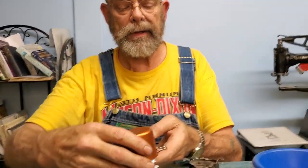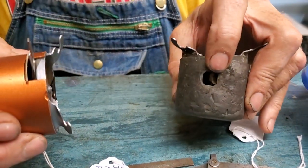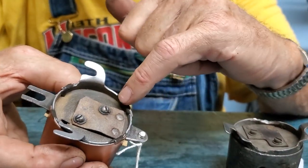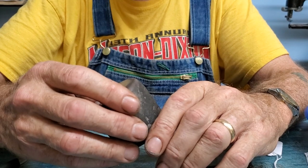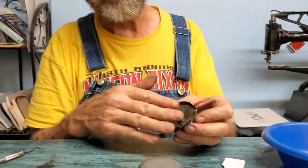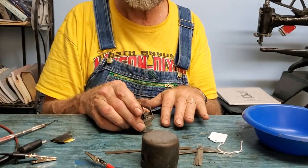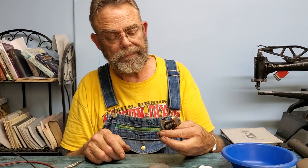The very early cutouts — up to January 1928, the copper-plated ones — are built quite differently. They have integral lugs and the cover is open on the bottom, with a cardboard insulator I make myself, so I do use a dab of epoxy on those when reassembling. For all the rest, they're essentially the same design all the way up through service cutouts made into the 1950s. Make sure you clean the bottom of these well on a wire wheel to get clean metal — the cutout has to ground on the generator. When installing, scrape a little paint away around the mounting screw holes on the generator so the cutout grounds properly.